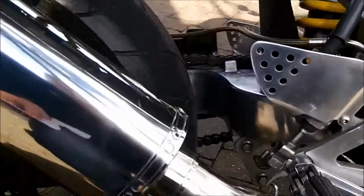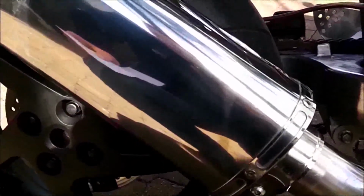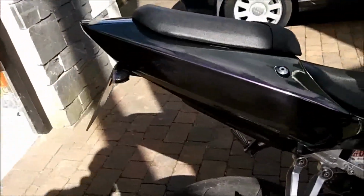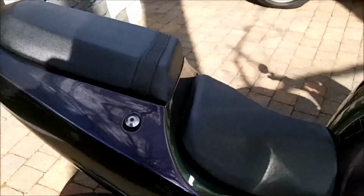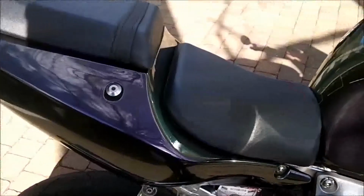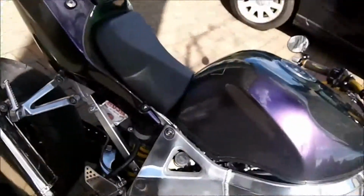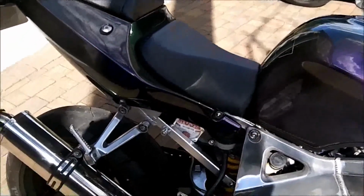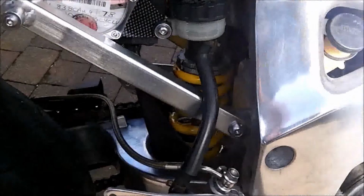The wheels are painted black, just a matte, satin black colour. And new indicators on the back as well, just the mini indicators. Because it's got LED indicators on the back and regular lamps on the front, I had to get a special relay unit, because the one I got from eBay, which promised that it would work correctly, didn't flash at the right rate. So a friend of mine took it to bits and got it to work correctly. He's a star, Dennis. So yeah, the other thing, the shock absorber, all-in.